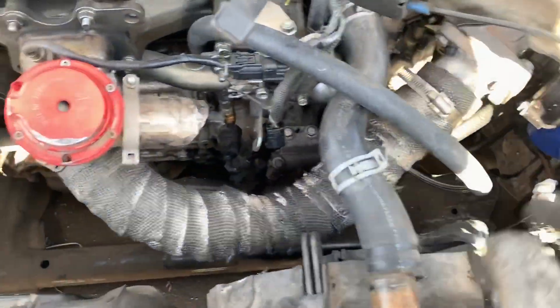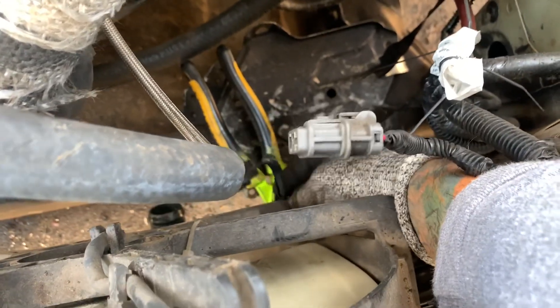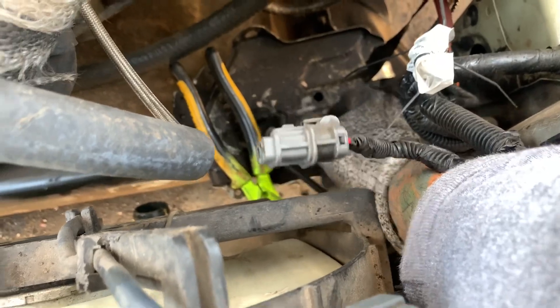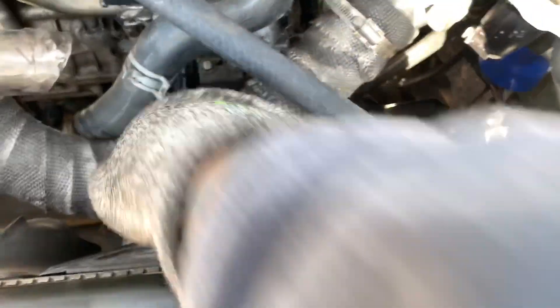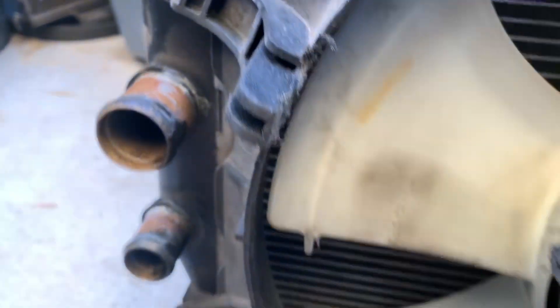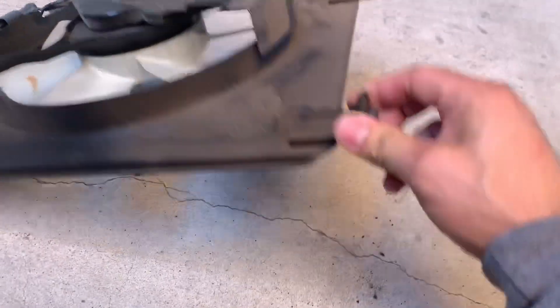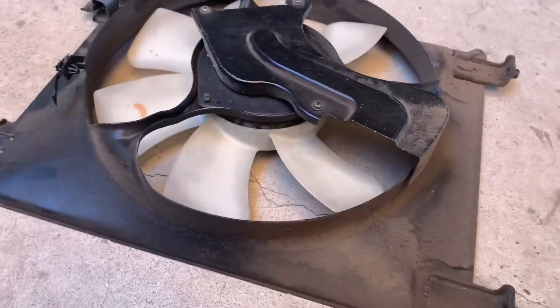Don't forget the clips or the fans. It just slides right off. There is one last connector in the bottom, this one right here. It's easy to undo but it's going to have a little clip. So if you're wrestling it and it feels like there's something still grabbing, it's probably that connector in the bottom. I'm going to take off the fans — I need to remove the two bolts on each side. I already did those. So this is the OEM fan. I'm going to pull the slim one out of the box and compare how much space I have now. I don't expect a whole lot, but we'll see.